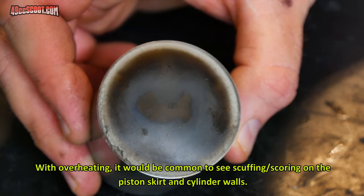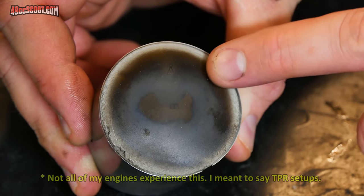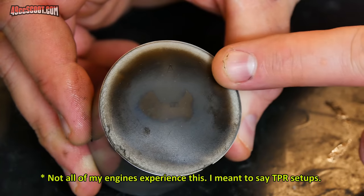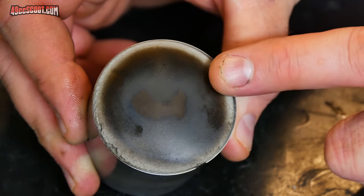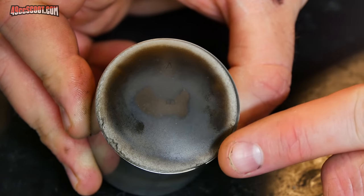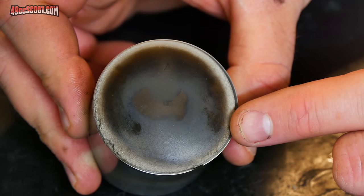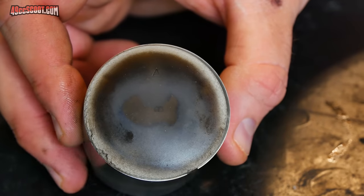In this case, I have seen this before. As I said, it's something that happens in all my engines that I usually have lack of color right around the edges. I know that I'm running 3 degrees advanced versus the initial MVT ignition setup specs. And I have ran it lean part throttle at times with the old carb, but this carburetor runs way more lean.